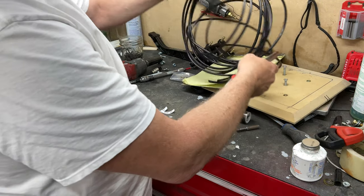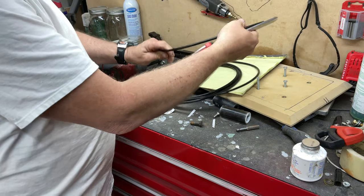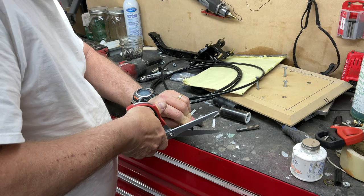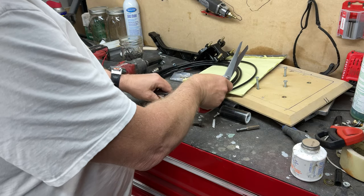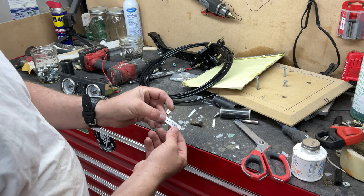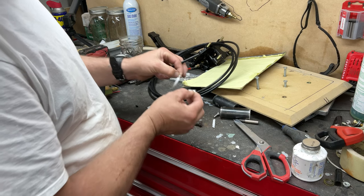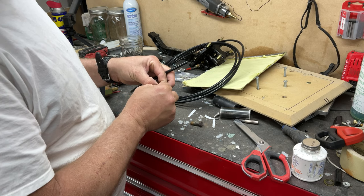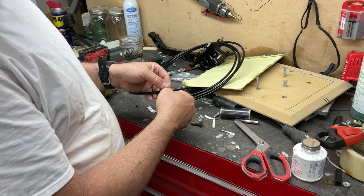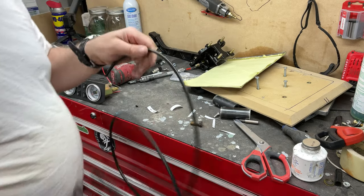So these are the air pressure lines — they come in one big roll. I cut that in half, then cut that in half again, and I get the four lines that go to the gauges. You want to cut these up nice and square. What I've been doing is marking each one of these lines. For instance, this one is 'RF bag' — right front bag. If you're not sure what's right and left on a car, it's when you're sitting in the car. This would be the right front bag, which is the passenger front bag. Then I mark the other end of it too.